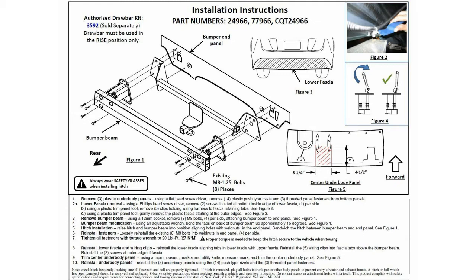You have to align not only the bolts, but there is also a hole in the middle on each side of the tow hitch assembly, and there's a hook or tab on each side of the bumper assembly that goes through the hole and through the hole on the frame on each side. That hole you will have to bend just slightly, as shown in the figure, to make it a little straighter so it'll go in a lot easier during installation.